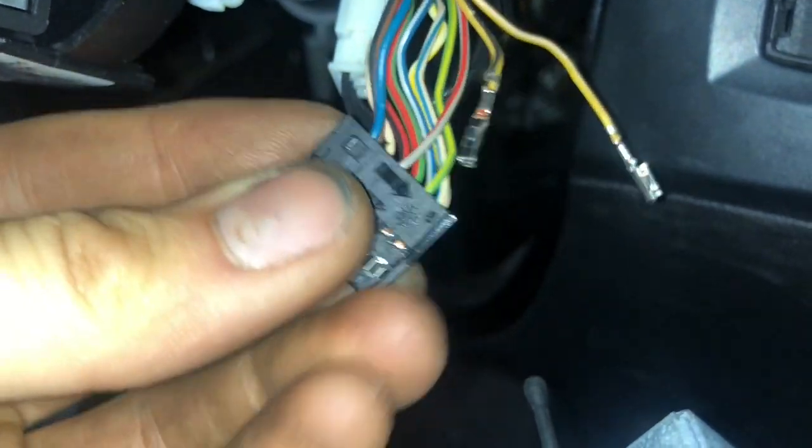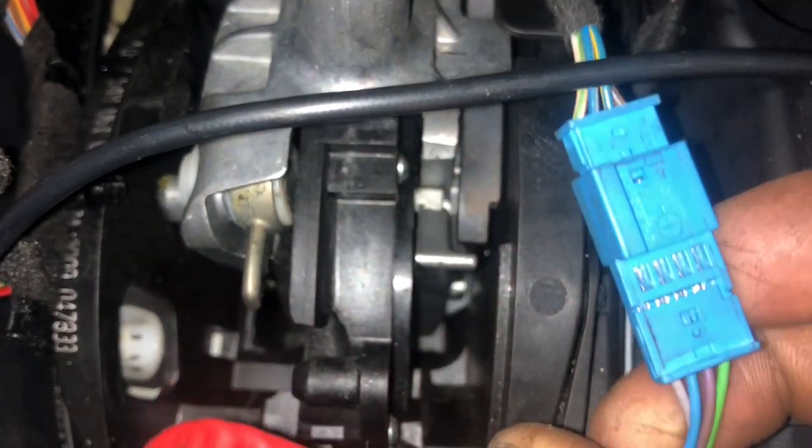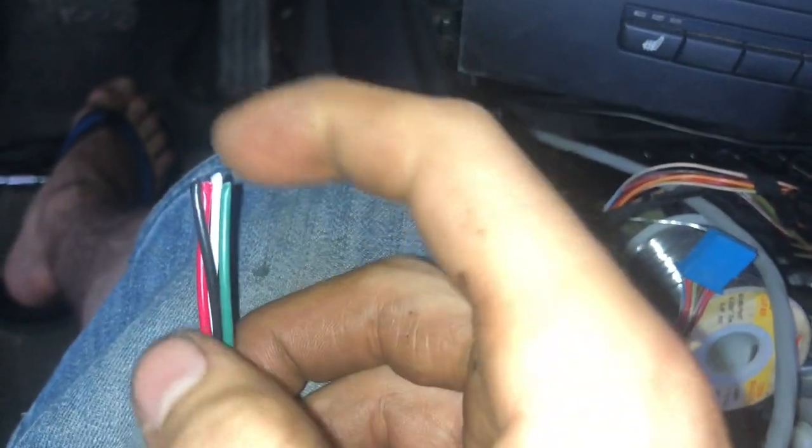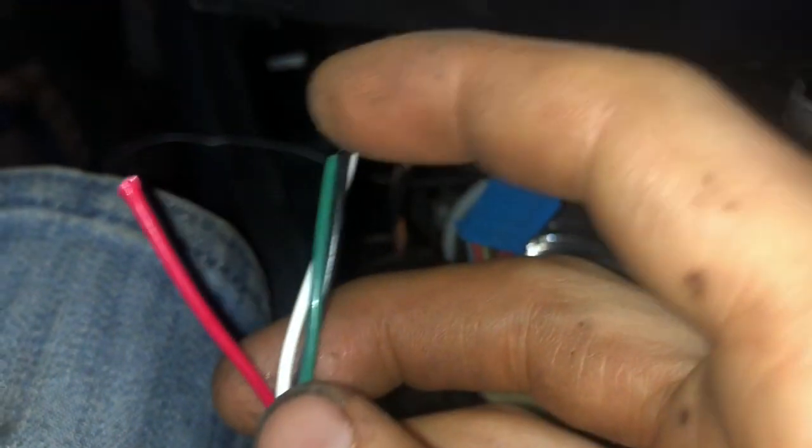So there's a one there and a six there. I've removed pin two and four — that's two, that's four. Over on this harness I believe it goes into three and two. I had this extra wire laying around; I've got red going to number two. This is all plugged back in — I just soldered them on instead of leaving the pins out, so I want to reuse the factory pins. We'll see if it works; if not, I'll have to disconnect it and put new pins in. Red is two, green is four — so you go two to two, and then four to three.